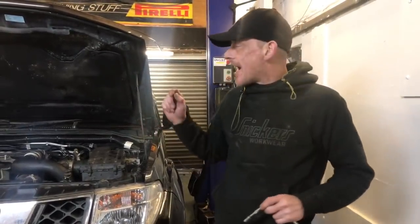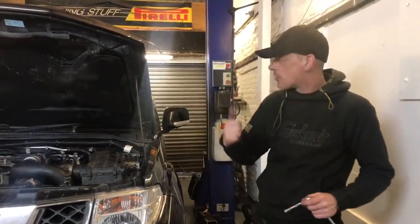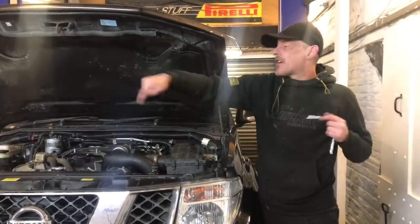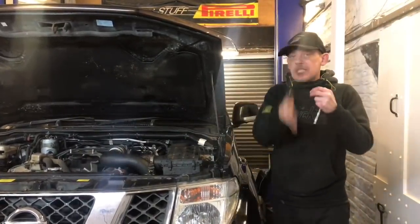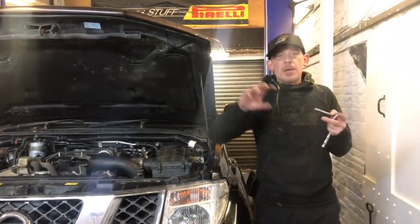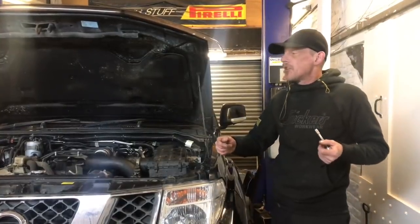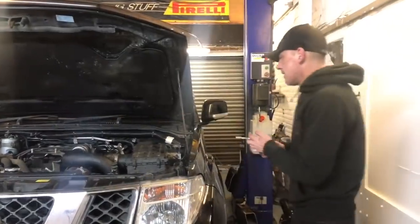The customer needs the car in 5 hours' time, so me and Nathan are flying on with it. I'm going to start with the airbox area. The EGR cooler is connected to your exhaust manifold. That's solid, it doesn't split in the middle like the earlier models. To get to the top timing plate cover, I've got to do that pipe, so I'm aiming for that first. Nathan's aiming for the radiator at the front end.